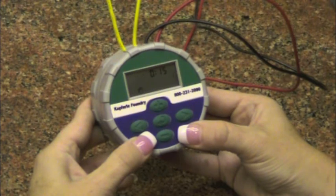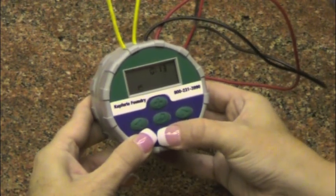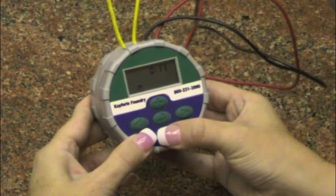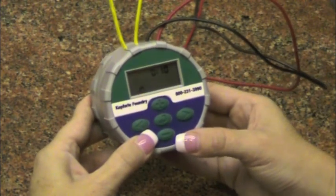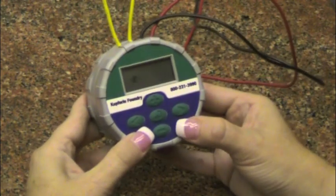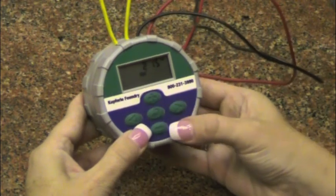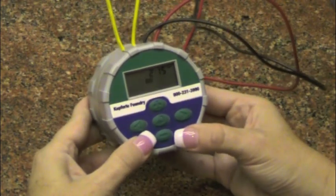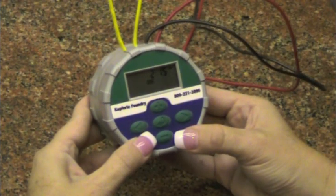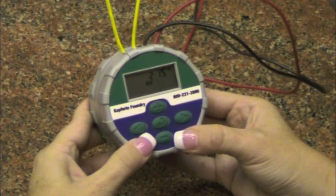If you do not want to wait for the test flush to end, you can either press the minus button to decrease the flush time, or press the main menu button to maneuver to the shutoff menu and let the controller fall to off mode. Please do not forget that once the controller shuts off, wake up your controller again by hitting the main menu key — otherwise your controller will not flush during the regularly scheduled times. Allow the controller to fall asleep on the home menu to continue your regular scheduled programming.